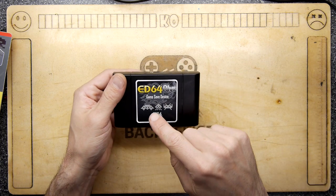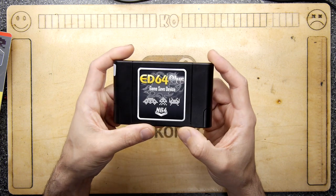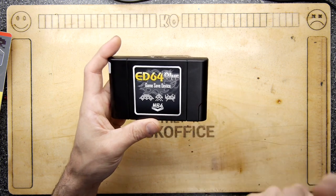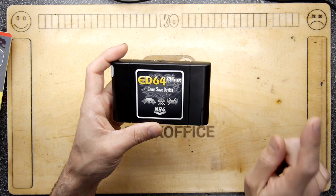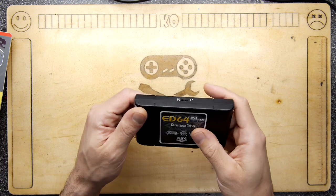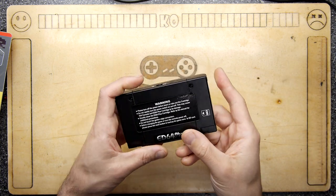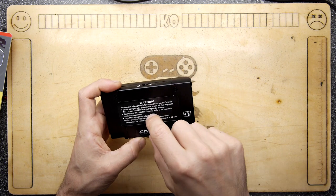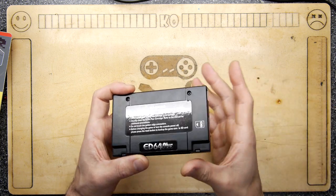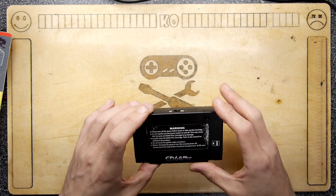The one gotcha: when you've finished playing, before you turn off the console, hit restart and wait for the menu to come up — that will save your game. It's very much like DS units where they have to power up to copy the SRAM. The save game is in SRAM and it has to copy it into a file. After that it's flawless and really easy to use — my kids took to it instantly.